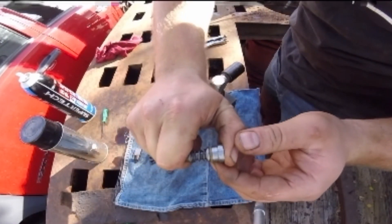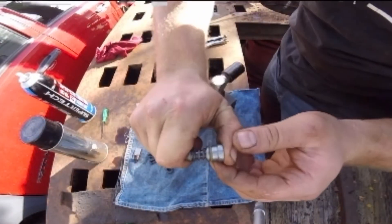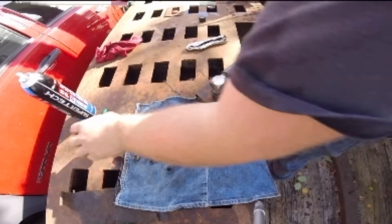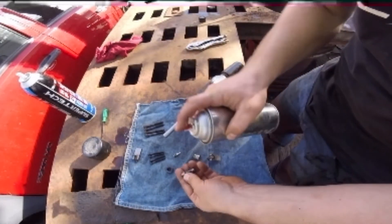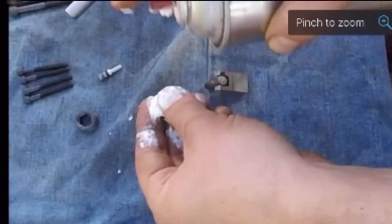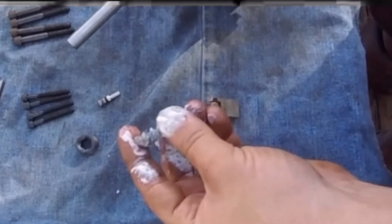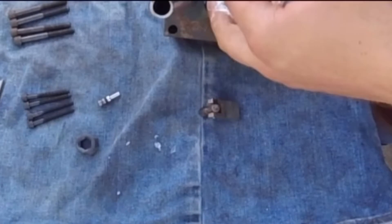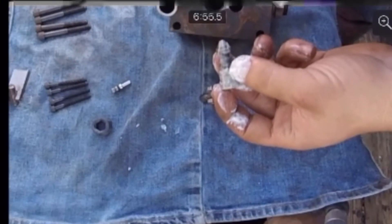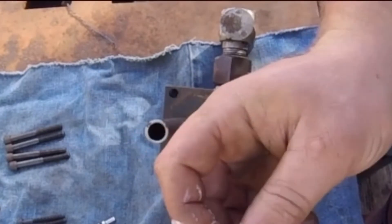This is kind of part of the pump — it's the hydraulic release valve. You can see I was squishing it right there; I had to get it freed up and polish those two parts. I'm greasing a few of these other parts here, and I guess that's the valve still right there that I'm greasing. Right here I'm showing you where you put it in the unit.